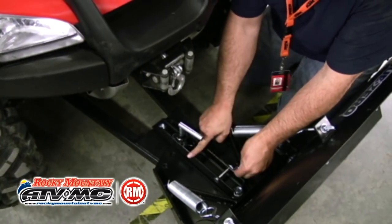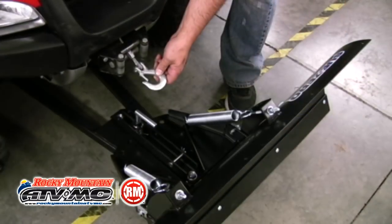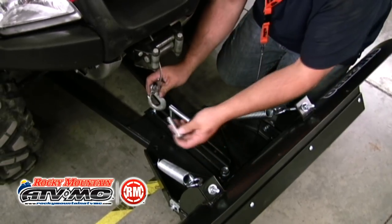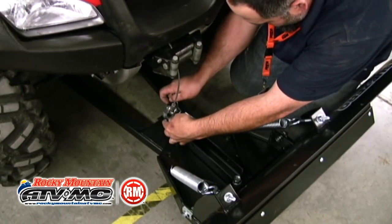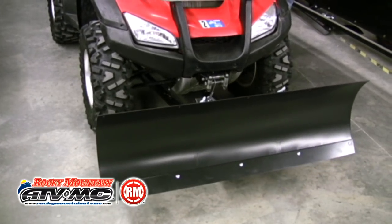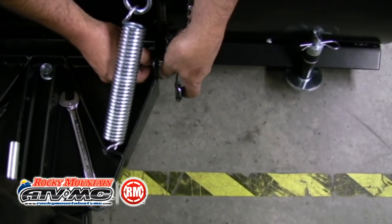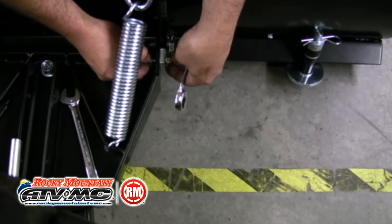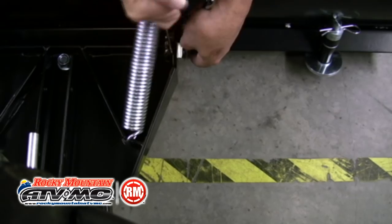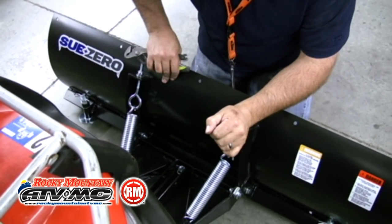You'll notice there are three positions on the blade angle bracket for the pin where the winch hook connects. You want it most vertical to get a better lift on the plow, so we're going to move it to the back position. Get the winch cable down there and insert the pin in that furthest back position. Now test the winch — lift the plow up and down a couple of times to make sure it's working properly. Then make final adjustments with the four-way tilt stop: by rotating it, you can change the angle of the blade depending on which side is resting against the blade. Once you get it in the desired position, tighten up both bolts. Then tighten the eye bolts so there's a little bit of tension on the springs.